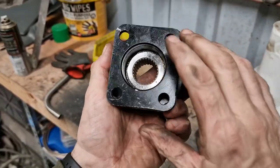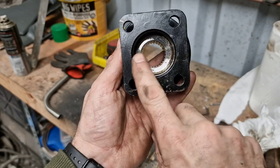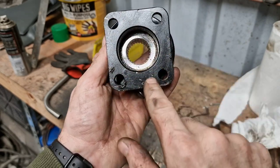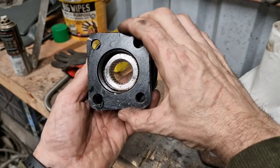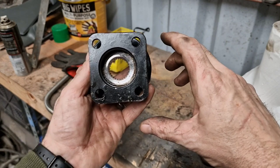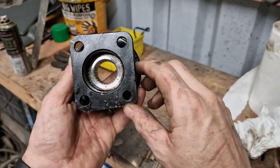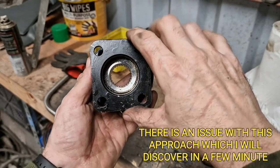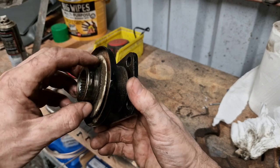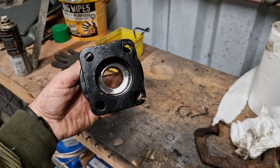So there is our flange removed from the end of the stub axle. When you actually measure these up you can see that this is not square — the hole to these bolt holes will all be symmetrical but the plate itself is not. A lot of the kits you see online that allow you to adapt this up to take the turbo Z31 shaft will just let you put that in there sloppily with no accuracy. My approach is going to be hub-centric: cut a hole out of the plate, put in a steel plate and weld it into position, then use that as the center point to cut a perfect circle and put in the four new holes.